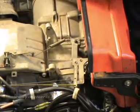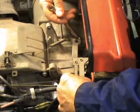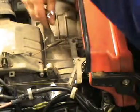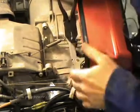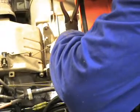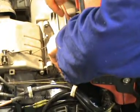I'll just set that now. I can put a pair of mole grips across there to lock it, but they'll probably get in the way of the camera, so I'll just loosen that off. You can see it's all floppy like that. So what I'm going to do is hold this — there's a little bit of movement in the governor — and we're holding it anti-clockwise. I'm going to pull that straight so the governor arm is just straight, hold that, and then re-clamp it up.